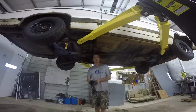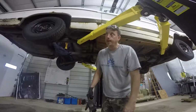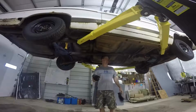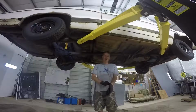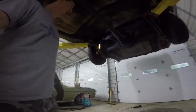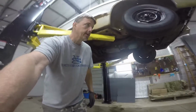Morning guys. So I had to take a couple of days off and anyhow, I'm back home to the Catalina this morning, and I'm going to try to get everything kind of wrapped up, get down off the lift, and test this transmission out, see how it does. So I got to finish bolting up the converter, bolt up the drive shaft and check to see what else I have to do. Drop it down, fill it up with fluid. So anyhow, it's kind of what we're doing.